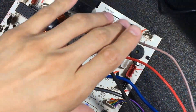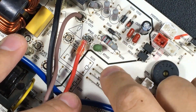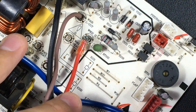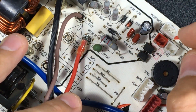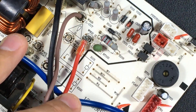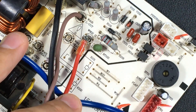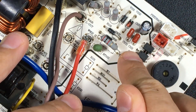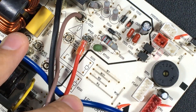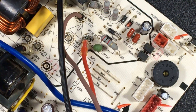Let's see the indoor board of this same model. Communication cable, PTC, resistor, two diodes, one zener diode, three resistors, capacitors, and optocouplers. Main component — always one on one side and the other on the other. Here we see the mark at point one and the mark at point one. These are the components responsible for communication.